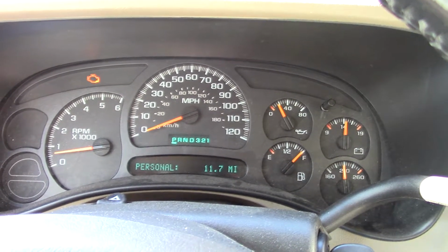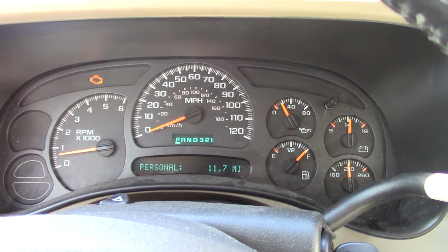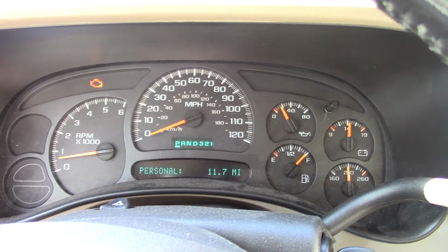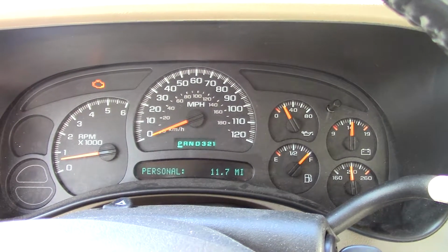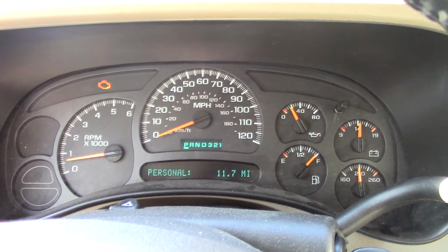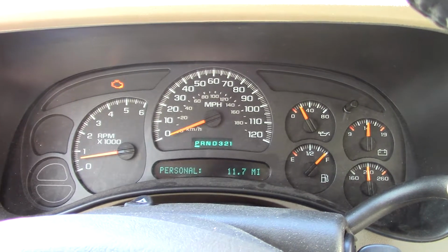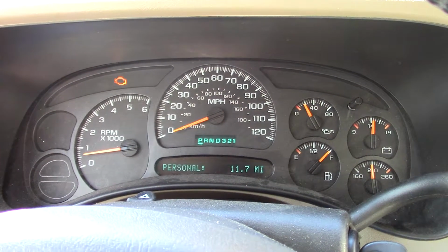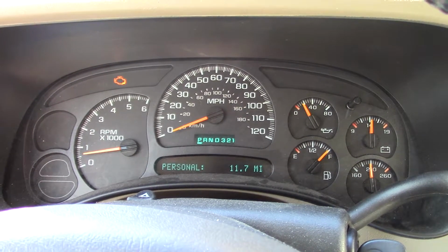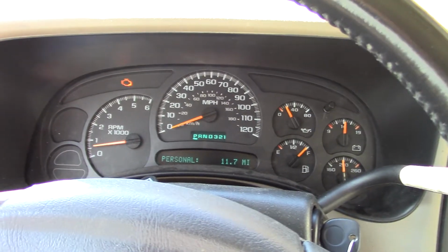A jack made contact with the tube, actually with the center section. The center section's on rubber. One side of the tube is not. It's actually solid mounted, and so something gave, and it was the housing. So I was able to buy a front end, which I paid way too much for, and I ended up just taking the tube off the one inside of the used front axle, and then put it on this one, leaving the center section alone.